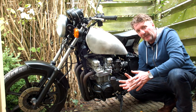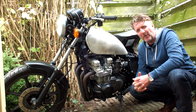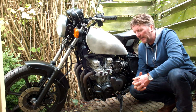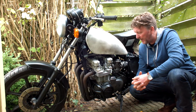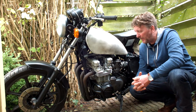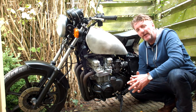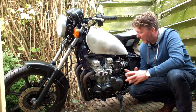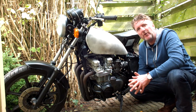and three of the intake valves, on this side of the engine, were too tight. They were about 0.04 to 0.05, and they should start at 0.08 at the tight end. So I still had my shims left over from re-shimming this engine a number of episodes ago. And I was lucky because exactly the shim numbers I needed I still had. So I changed out 3 shims on the intake side, and all 8 are now correct.